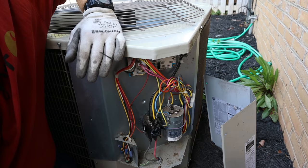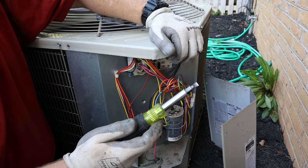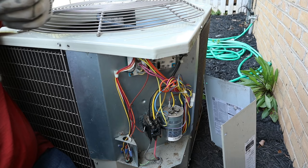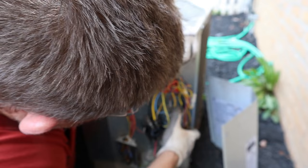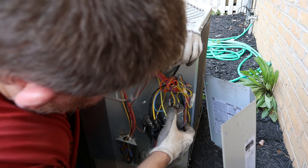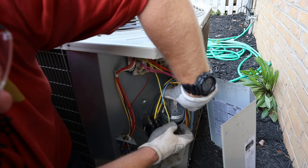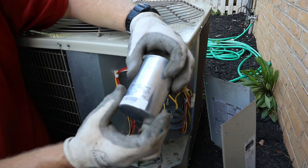To relieve the stored power from the capacitor, take a screwdriver with a rubber insulated handle and put it across the two prongs to discharge it. Mine's been off a long time so I know there's no charge, but I did it anyway just to be safe. Then loosen the capacitor up and slide it out. Take a look at it — a lot of times when capacitors go bad they'll bulge out on the top or bottom, but this one shows no visible sign of damage.